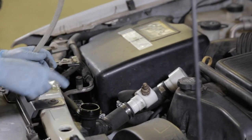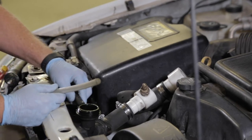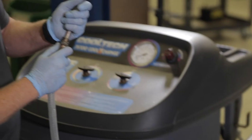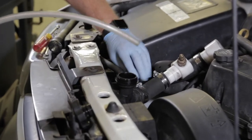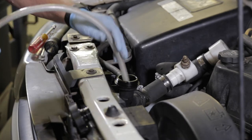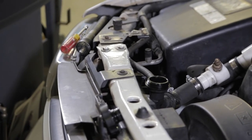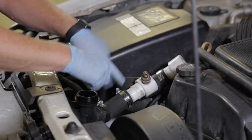So we pull off the radiator cap. Your upper hose would be connected, so we're getting ready to swap this over and put these adapters in. We would reattach the overflow hose, put a clamp on it, and then on that same vacuum setting, take the hose and put it down in the radiator and draw the coolant down below the level of the upper radiator hose. This is so we can disconnect the upper radiator hose without dumping a bunch of coolant — it's a much cleaner way to switch this over. We would leave it on that vacuum setting, suction the coolant down in the radiator, then turn this back off and set it aside. Then take the upper radiator hose off, put our substitute short hose on here, and mount our two adapters with hose clamps all around.